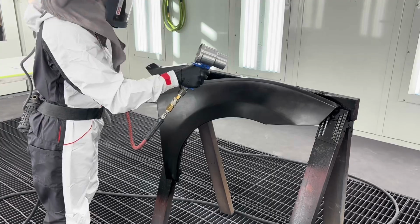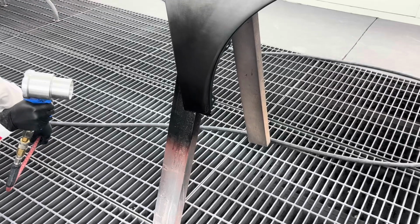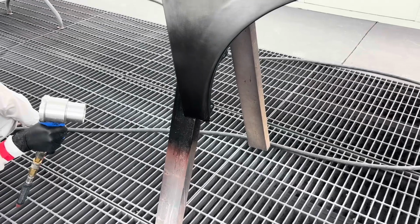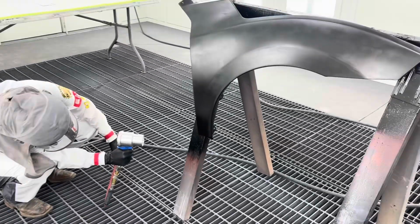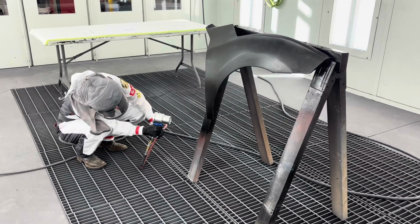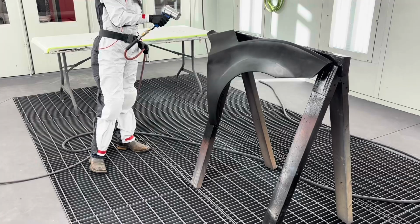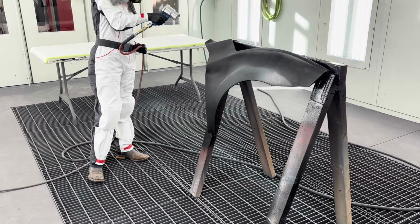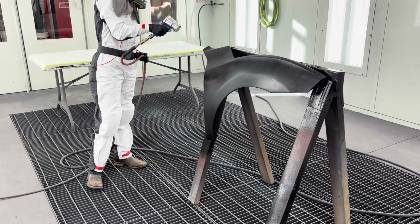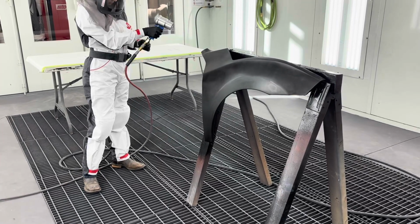As we continue to watch the paint dry here, we can see that almost the entire panel now has this matte or dull color. The bottom of the fender is still a little bit wet. You'll find that areas that are hidden, where they don't get a lot of direct airflow from the paint booth's air movement, will take longer to dry. That tends to be bottom sides of panels, areas closer to the floor, and other areas that lack good airflow, which could partly be caused by the way you have the booth loaded with parts and the vehicle. Continue to dehydrate the paint until you're 100% sure all the water has been evaporated. And we'll talk a little bit later about a really good system we have for ensuring the complete dehydration of the base coat.